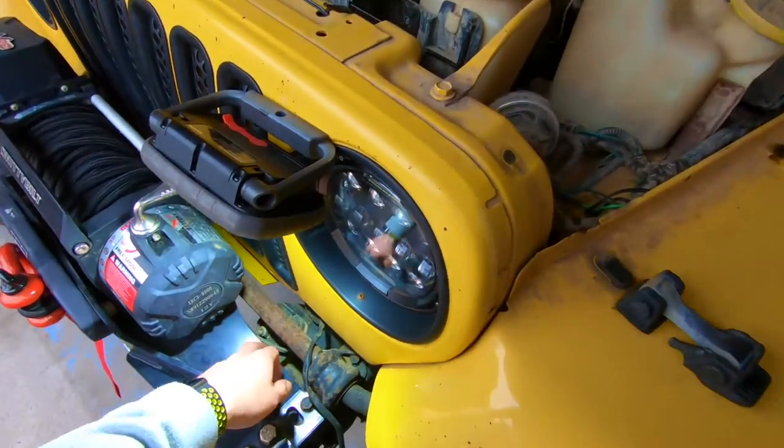I will move mine around a little bit just to see if it helps, but I don't recommend going too far with it because your steering box will just go out quicker. Changing the steering box isn't a lot of work and it isn't that expensive. Look into your different options — some people go for the Durango box, which is a little better, but it is out of an independent front suspension setup, so it's configured differently. Do your research on the forums and see which one fits your uses — bigger tires, off-roading, or daily driving.